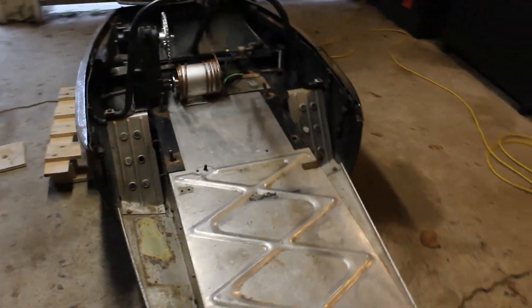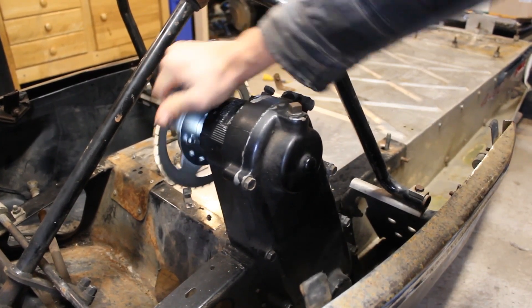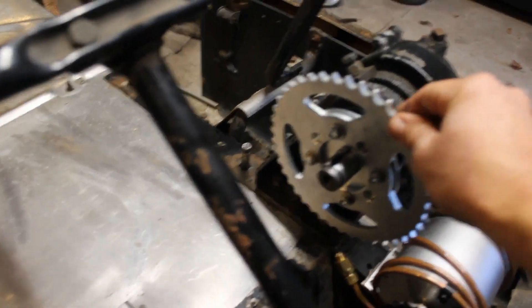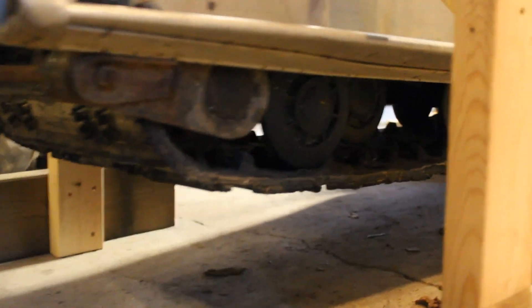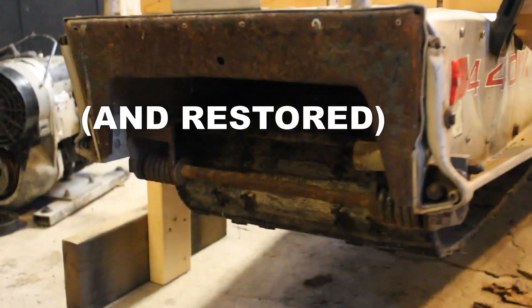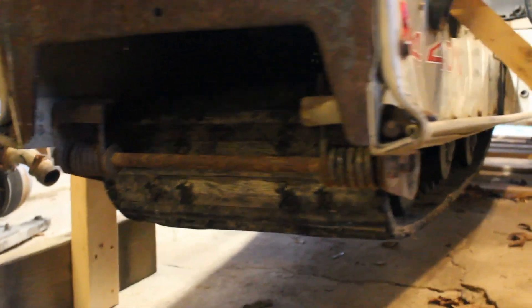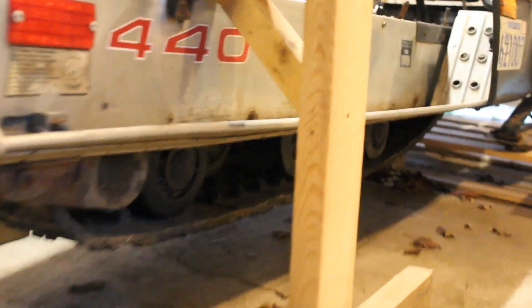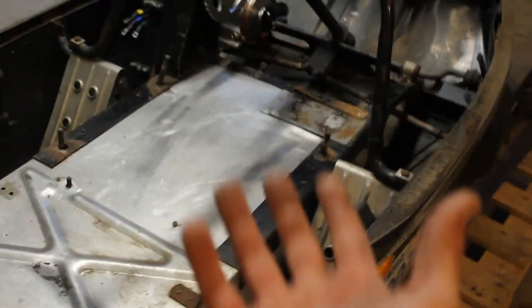That's very satisfying. Now that that's there, you can easily get leverage and start moving the track around. So I'm taking a first look at turning the track by using this crank. The track looks okay at first inspection, but it does seem to be binding up on something. I suspect it needs to be aligned after having this back corner all smashed in. So I'm going to have to pull out the rear suspension, the bogey wheels, and pull the track all the way out — and that'll allow me to build my motor mount here as well because I'll be able to get up underneath.